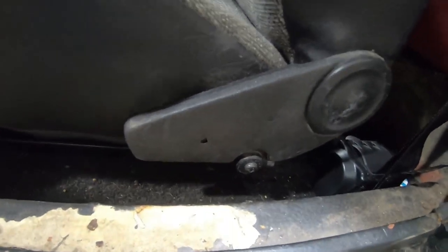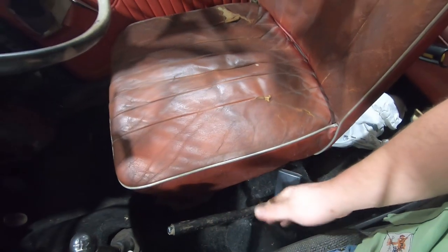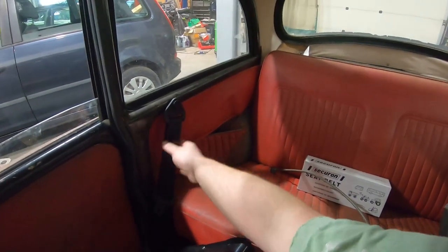It kind of wants to be about there, so we're definitely going to have to put a spacer under the back. But height-wise, you can see compared to the driver's seat there's not a great deal of difference. It's comfy, it's very supportive at the front - the front's possibly a little bit high. Height-wise I've got plenty of headroom and plenty of room down here. I can move the seat over a notch. I've got new seatbelt buckles to put in to go with my new seatbelt. I didn't like the inertia reel being at the top - it made it really awkward because they like to be at a specific angle. I might need to lower the front or raise the back a little bit more, but I could live with this - it's pretty good.